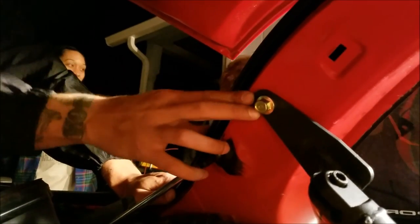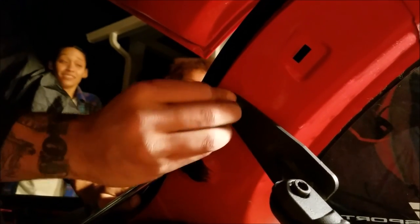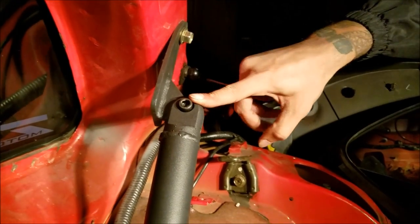We used the passenger top part for the seatbelts in the back seats. Basically you remove those, put the bolt in, and then you want to attach the support plates to the bar first. Attach the plates - this is the harness bar right here - and it comes with these pieces not attached to it. So what you want to do first is attach the harness bar to the plates and screw them in first. Then slowly screw each side in a little bit - 50/50 each way, keep going back and forth. Just hand tighten them at first.